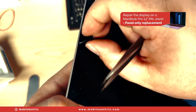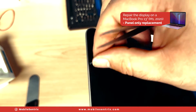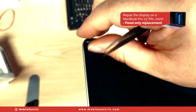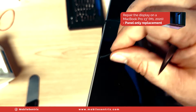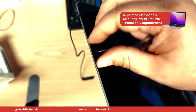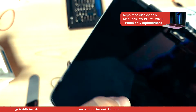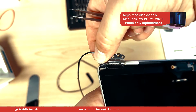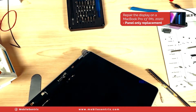There's a little nub that gets caught, so we'll gently inch along, barely putting any tension on it. In the corners it gets tough — just keep going around the border without tugging too hard. It's quite difficult to tear these but they can tear, so take your time. We can reuse both the bezel and the adhesive below. At the bottom it gets more difficult, so just pry it up with tweezers and set this aside.